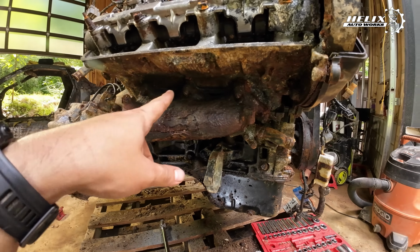So, the crank wouldn't turn. There are some seashells in between. So there's water inside of the heads and the intake manifold. There's also water on the spark plugs. So what I'm gonna do is remove the valve cover and remove the head and cut this area, see if we can turn it.